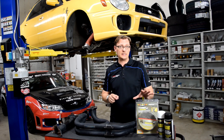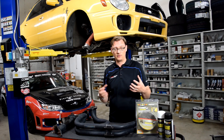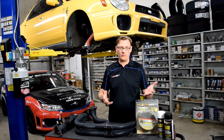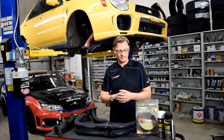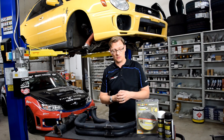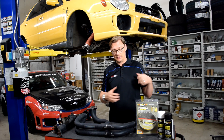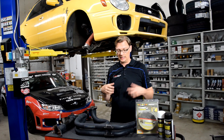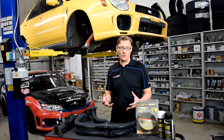The header wrap is a much more effective thermal barrier than the ceramic. You can do multiple layers and get really aggressive with it if you choose. It's going to keep a lot more of the heat into the exhaust and away from engine components, and that's kind of where we realize we need to go with this.